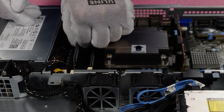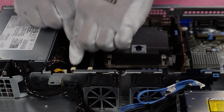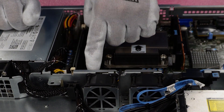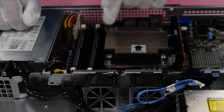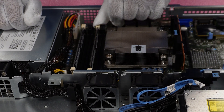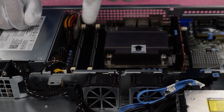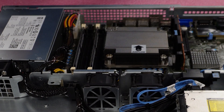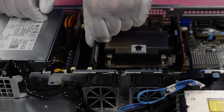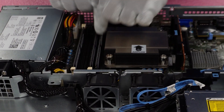That is the most common user error that we see — customers who think they have a bad DIMM slot when realistically they don't have the module fully seated. Even if you have the tab out just a little bit, that'll make it not fully seated. It needs to be all the way in. Rotate your DIMMs around if you think you have a bad DIMM — find out if it's the DIMM or the DIMM slot. Just move them around; it's the easiest way to troubleshoot, and a lot of times just by rotating them around, you will resolve the issue.